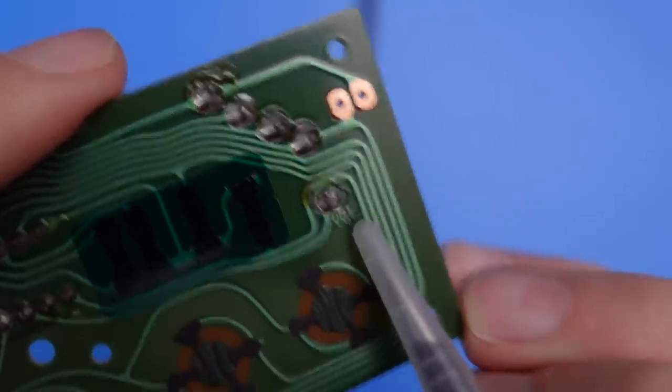On the NES004 that I opened, the yellow wire is connected to the serial output pin — the one that sends data for each of the buttons back to the NES. The red and orange wires are connected to the data clock and latch pins, respectively, and are used by the NES to instruct the chip on how to record and then send that data. Depending on when or where your controller was manufactured, the meaning for the red and yellow wires might be swapped. For my controller, it was pretty easy to figure out because the yellow wire was soldered into a pin on the board that was literally labeled OUT.